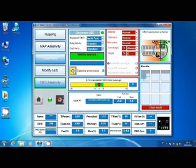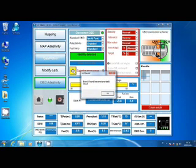Okay, you now see a yellow button, okay? The ECU is telling you, yes, I found an error to erase, but it's not on the list. To check which error it is, simply click on the button. Here's the code, P0115. As you see here, error found, erase not provided. So if the ECU finds an error like this, it will not send an erase error request.